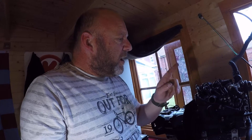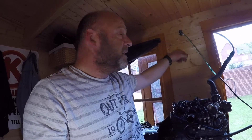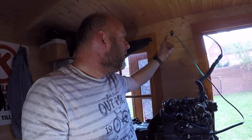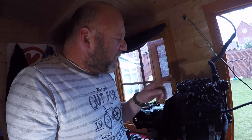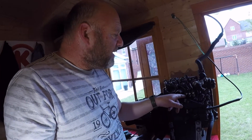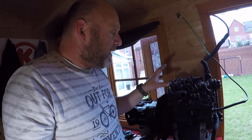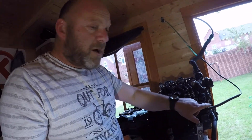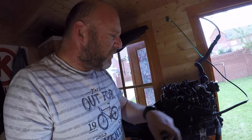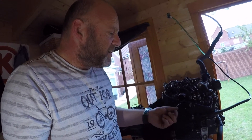I've also hooked up some fuel as well. This is a dummy fuel tank made up, so check out that video as well, I'll put the link up there for you. But basically now it's about bleeding these lines before I can actually start the engine. So what you need to do, obviously you get your fuel pouring in and then you need to open up your throttle valve as well, and then you've got various points that you can actually bleed the system.